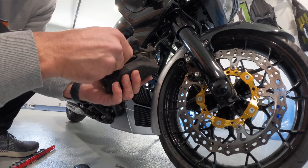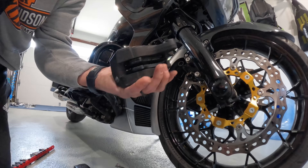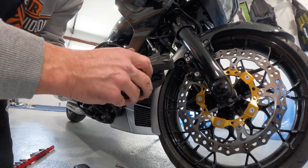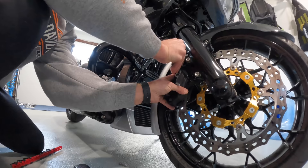See right there — now you can take out the pads. Now we're going to put our new ones back in, then put our bolt back in. There's a little tiny cotter pin right there that goes back onto that bolt, which provides extra protection and prevents that pin from coming out. Then some blue Loctite on the bolts for the caliper.